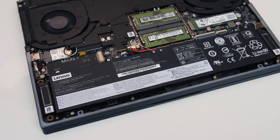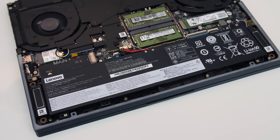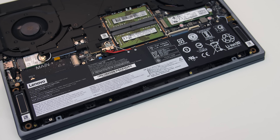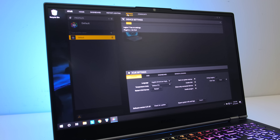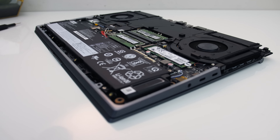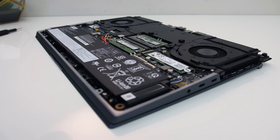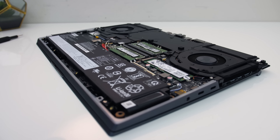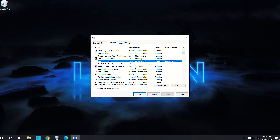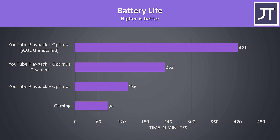The latencymon results were looking good. The 7i is powered by a 4-cell 80Wh battery, and there's a serious battery issue to be aware of. By default, while sitting idle doing nothing, it's drawing about 50 watts from the wall in Optimus mode with RGB lighting off. After investigation I found this high power draw was due to the Corsair iCue software. Killing the processes in Task Manager would dip power draw to 10–20 watts from the wall, but it would rise back up shortly after. In the end I uninstalled the software for testing, but later found you can just disable the Corsair service, and you can still control the lighting with iCue.